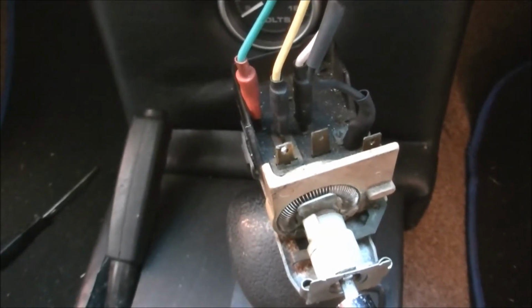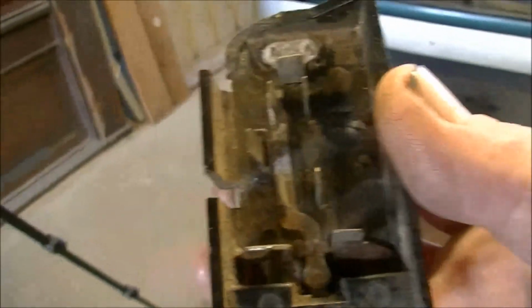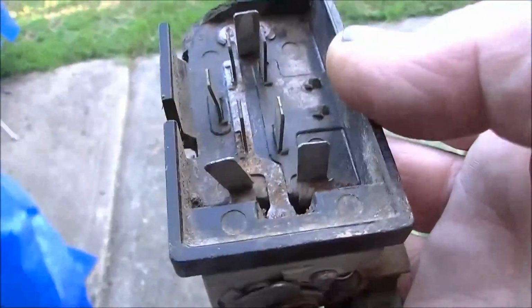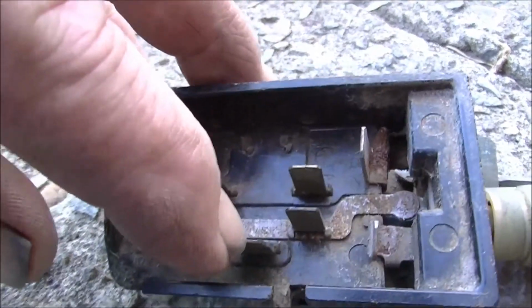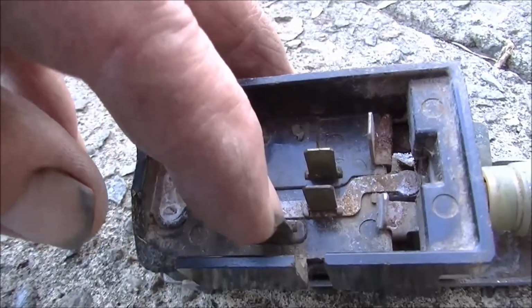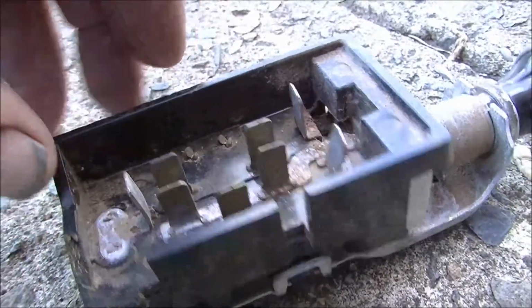It really wouldn't be too much harder to suss out with this one which is which, because it does have similar things. We'll come out in the daylight here. There's the one with the double, so that would be the park light. That one there's probably the headlight. You've already got your power and your earth and your headlight, but your issue is the park light. So make sure your park light one goes to one of these ones that's joined, and you should be good as gold, bud.